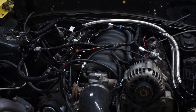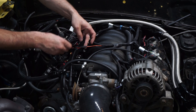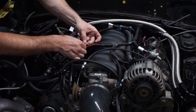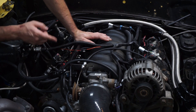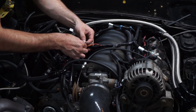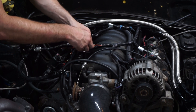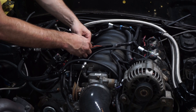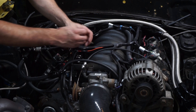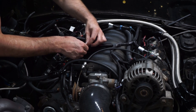Since I have the known-good coolant pressure sensor working, I'm going to take the power and ground off of that circuit. I could probably use the same input wire — I just have to look at my coolant pressure circuit and see if it gives me a reading. Or I could do a separate input and show how to configure that. The five volt and ground you can grab off of any other five volt circuit — splitting them doesn't affect other circuits.